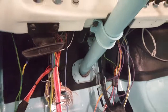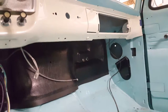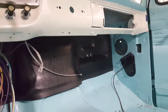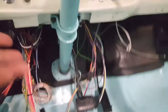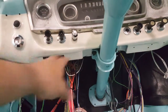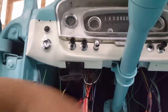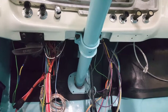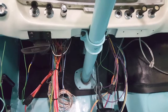I also found out I did some stuff out of order. I finally got the firewall cover ordered — a nice insulated firewall cover molded to fit, the LMC one, not the Dennis Carpenter one, though they look exactly the same. I should have started with that. I ended up pulling all the wires back out of the firewall, disconnecting the emergency brake cable, steering column, gas pedal, choke cable, speedometer cable — all those things — bringing them back through the firewall, putting the firewall cover up, and then bringing everything back and basically rewiring the truck all the way to the taillight wires.